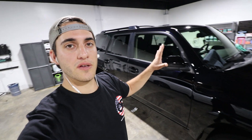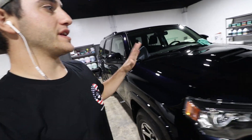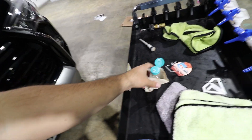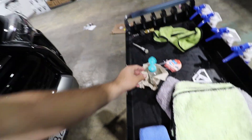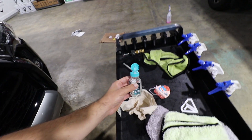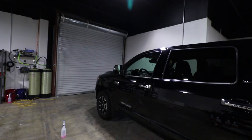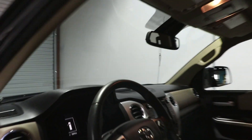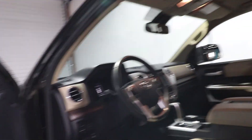Once the vehicle is perfected and stripped down with no oils or waxes left behind, you're ready for the coating. Here's the Owner's Pride ceramic coating — this is their three-year coating. We have products in stock; feel free to email me at genesisdetailingsd@gmail.com or DM us on Instagram at Genesis Detailing. Also remember, after the panel prep, go through the door jambs and clean up all those cracks and crevices — polishing dust gets in there and if it gets under that coating it will mar the surface.